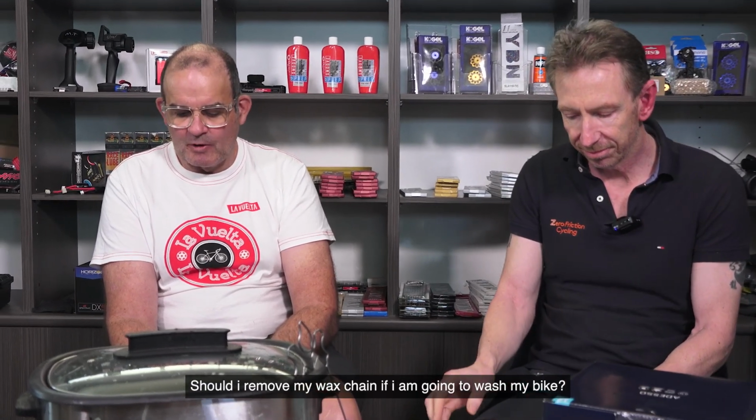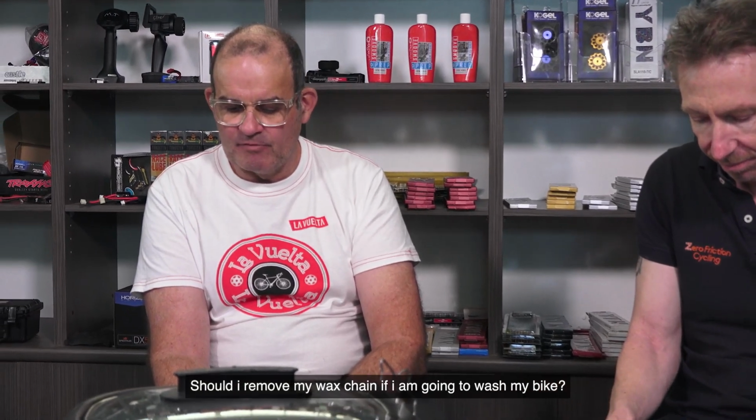So, yeah. Okay. Should I remove my wax chain if I'm going to wash my bike? Yes. Really, with any chain, you don't want to water them with your garden hose and detergents if possible. Again, I'm a bit surprised how many people actually do a full garden hose wash on their road bikes and only ride in the dry.